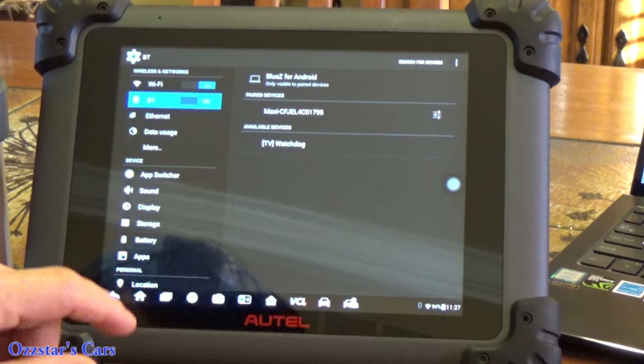It found the VIN number. We press OK — this is a 2011 US model. It's a Quattro. For vehicle engine, we've got a couple to choose from. You should check the engine code — on this Audi, go to the trunk, lift the carpet on the left side by the spare tire, and you'll see the engine code, transmission code, and other info. It's kind of like GM's RPO codes. It's a 2.0-liter turbo — CAEB is our engine code. We'll click Yes.